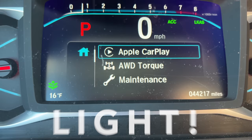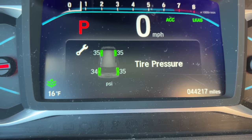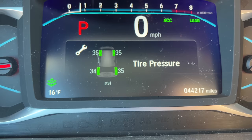The next thing I check is the tire pressure monitoring system. This vehicle does have a readout for each individual tire, so I can see that each tire has approximately the correct amount of air pressure in it. If there was a little light illuminated — it looks kind of like an inverted balloon with an exclamation point in it — then I would think possibly that the installer broke one of the TPMS sensors while installing, and I would want to go back and make sure that's corrected before I leave.